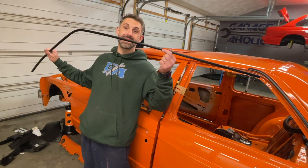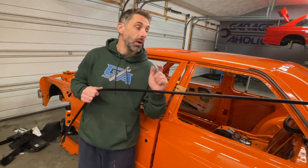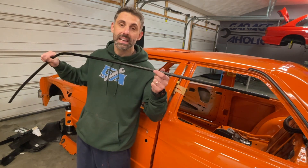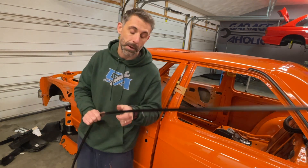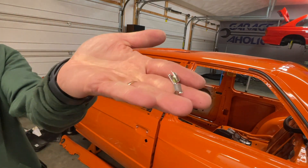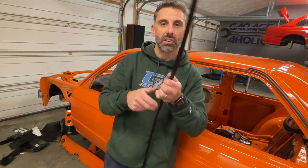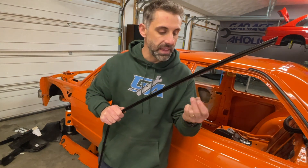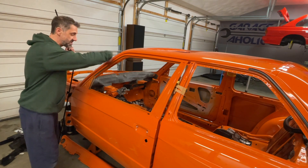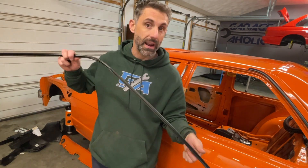Now comes the fun part — this big guy. This happens to be a brand new OEM piece; it was shipped in a box bigger than this. Whenever you're doing a replacement, paint job, or something like that and this piece needs to come off, it's really not that hard — it just takes a little finesse and technique. Because this is brand new, it requires these little clips, which install down the A pillar side and sit inside of here. They grip on the body side, and without them the trim is just going to fly out — definitely going to come out, and you need these clips.